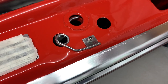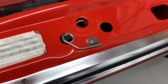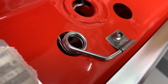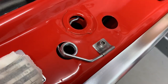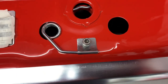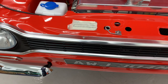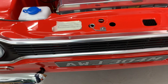A little job I've just completed is fitting the bonnet release spring. I bought the spring and it didn't come with the little clip. When I tried to find the clip, you can only seem to find it with the spring, and I'm not paying another £29 for another spring just to get the clip. So I came up with the idea to simply make my own. I measured the outside diameter of the spring — which is 4mm — and I formed a little bit of stainless plate around a 4mm drill bit. Cleaned it up, fitted it with a stainless bolt, and that little job is out of the way. The next jobs will be to take the grille off, connect the cable to the spring, fit the horns, connect up the radiator fan — do it all in one go while the grille's off.